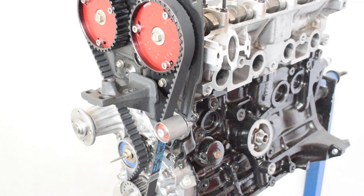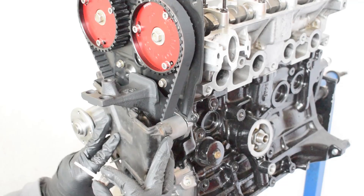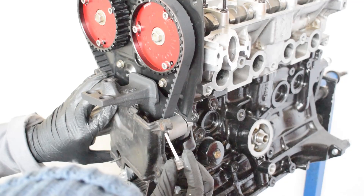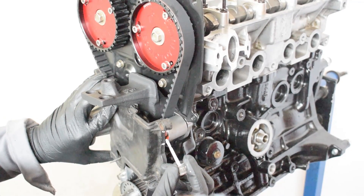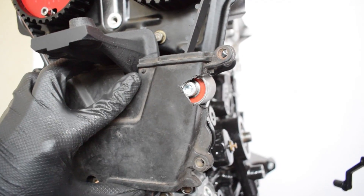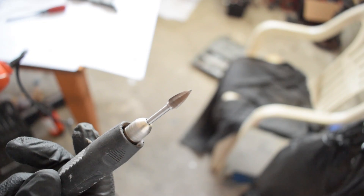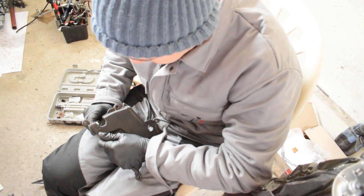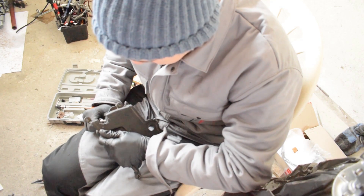Once you install the back plate and the cam belt stabilizer it's time to modify the middle part of the timing belt cover. This process is almost the same as with the back plate, and the only difference is that you're dealing with plastic instead of metal, which means you need to take extra care not to damage something beyond repair. I started with a cutting disk attachment to remove a big chunk of the timing cover. Once I test fitted this I proceeded with a carbide burr. The carbide burr may not seem like the right tool for the job, but it removed material at just the right speed and really helped me make the final shape of the hole for the cam belt stabilizer.